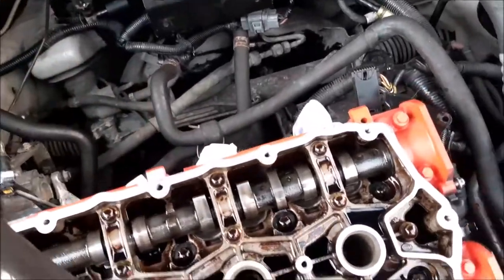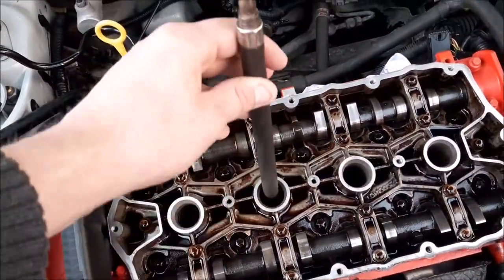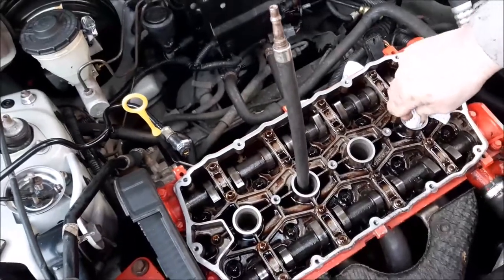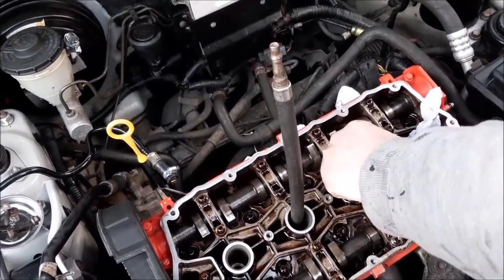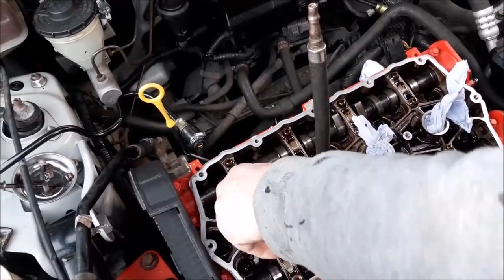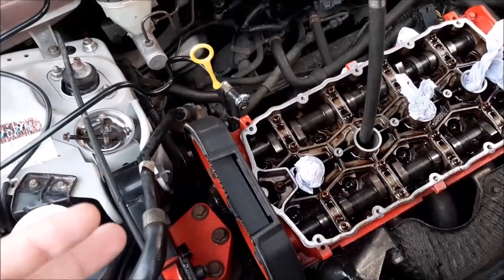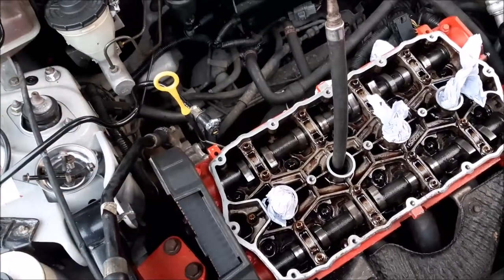You can see that all the spark plugs are out, and this particular cylinder has got our testing hose in, where we're going to pressurise each cylinder with a low amount of pressure from our compressor, I think around about 2 bar, and what that will do is we'll see if any air is leaking through. But you have to have the valve shut on each cylinder to obviously make sure you get the pressure build up to see if it is leaking through the gasket.